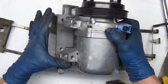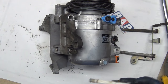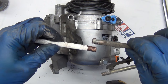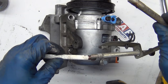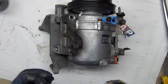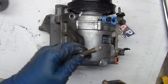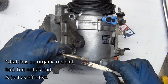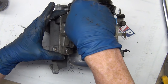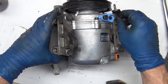The old bracket was totally unsalvageable because the bolt was hopelessly stuck in there, so this new bracket bolts up the same as the other one. Before all these go in, I'm going to use some anti-seize. Every time you have steel going into aluminum — especially where roads are salted or chemical compounds are used — things can really get stuck together with dissimilar metals. You want to be able to get it undone someday, which is why we're taking the precaution of putting anti-seize on it.